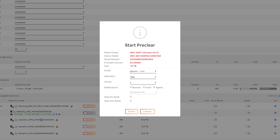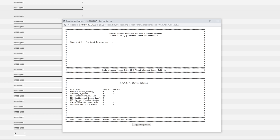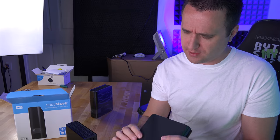Once you click the preclear icon, a dialog pops up where you select how many passes to run, make sure you're not skipping reads or writes, and you can set up browser notifications for when it's done. Click Start and a status window shows the progress — you can close it without interrupting the process. That's all you need to check these drives without physically shucking them, avoiding any potential warranty or return issues. If a drive is DOA, you can simply return it to Best Buy rather than dealing with a warranty claim to Western Digital.